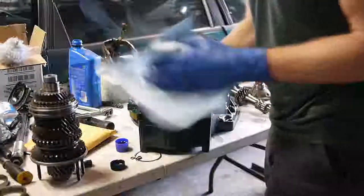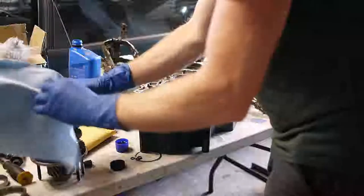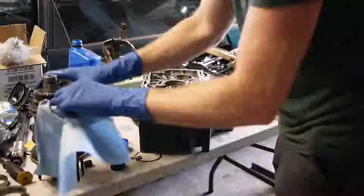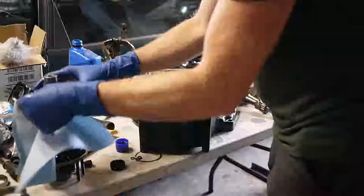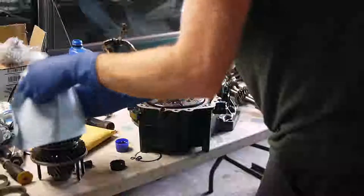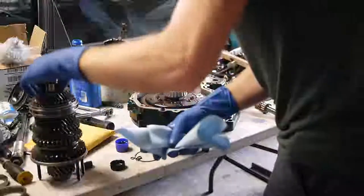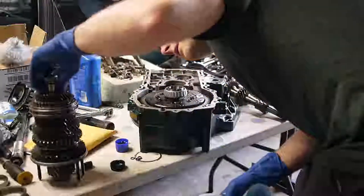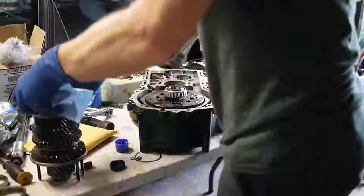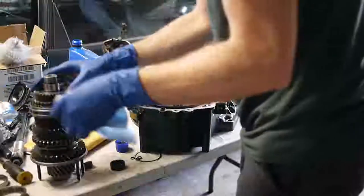And go ahead and clean this off just a little bit. Got some dust from settling overnight. I'm going to probably go 500 miles on the fluid and then change it. And I'm going to stick to a regimen where I change my gear oil every so often. Probably every other oil change, because I kind of want this transmission to last a long time, as I explained when I was doing the clearancing.